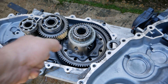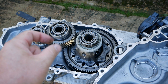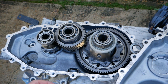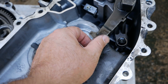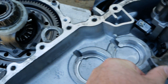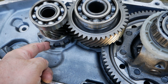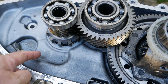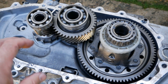When you park your vehicle properly and apply the handbrake first, the weight of the vehicle is on the brake pads at the rear - they're designed to wear and are very cheap and easy to replace. The weight of the vehicle isn't on the gear set, so when you select park the park pawl locks the transmission and engages easier into the gear set because it's not holding the vehicle's weight. It also disengages easier, resulting in much less stress on all the components and a much longer life.